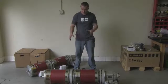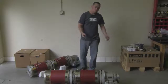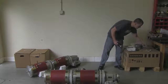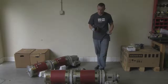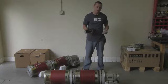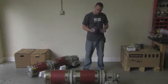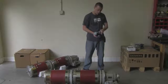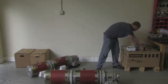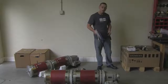We have the two motors bolted together now and we also have the PowerGlide bolted to the last motor. We should talk a little about the hydraulic system. We don't run a torque converter with this PowerGlide, so when the motors are not turning we have to supply hydraulic pressure with this pump to keep the clutches engaged. It comes with good mounts and a rubber perch which keeps it real quiet. We also supply fittings, hose, relays, wiring — everything you're going to need.